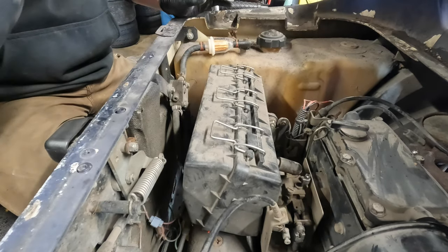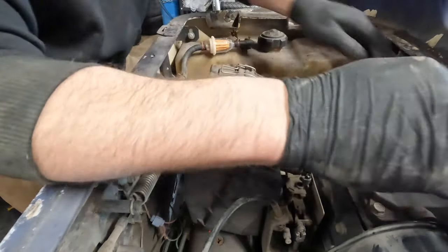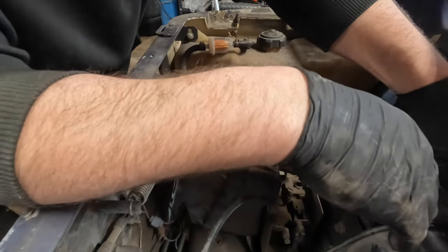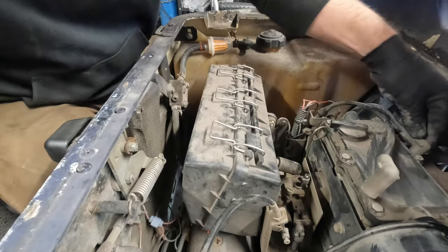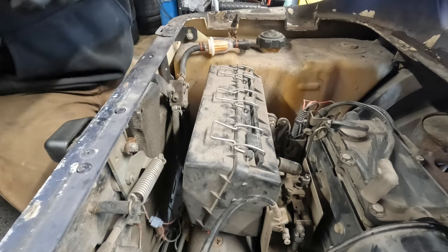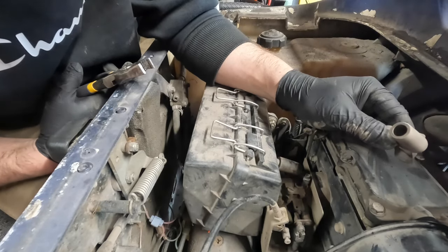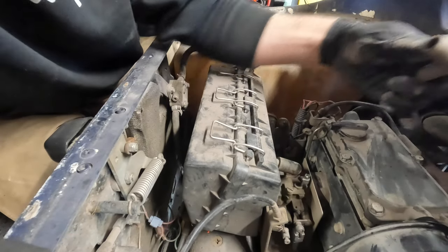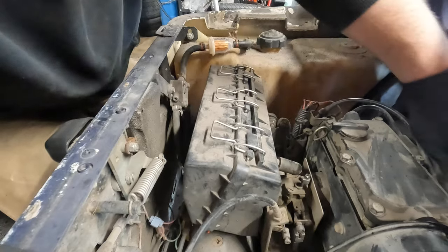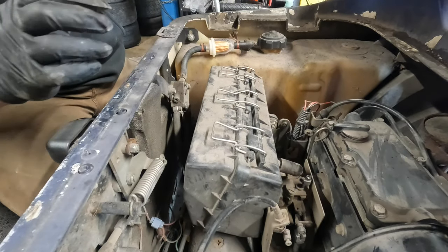Okay, so now that we've got spark good, hook up our spark plugs. Yeah, that's a little loose. I'm going to squeeze that a little bit. Our spark plugs are good. Our oil change and filter are good. We cleaned that. I'm just going to pinch the tangs inside that. There we go, that's better. Fuel filter, air filter.